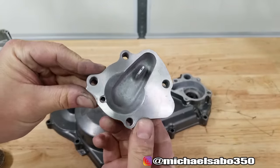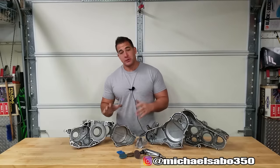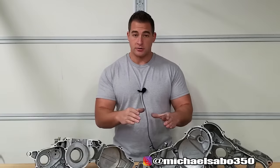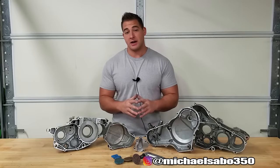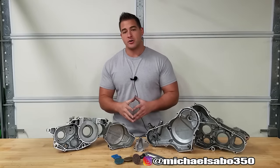Give it a look at our water pump cover and our stator cover. These gasket surfaces are ready to go, and realistically in the condition they're in right now you could put this motor back together with fresh gaskets and it shouldn't have any leaks. There is one step further you can go to ensure your surfaces are completely flat — it's called surfacing. I'm going to be doing that with all these cases after they come back from vapor blasting at DBC Racing. Cameron Niemela just put out a video showing an excellent process — super cheap, just sandpaper on a flat surface and rotating the covers on it. Be super careful if you use this process; once you get the hang of it you're never going back. If you haven't already, check out the 250r series, hit subscribe, and I'll see you guys Friday.